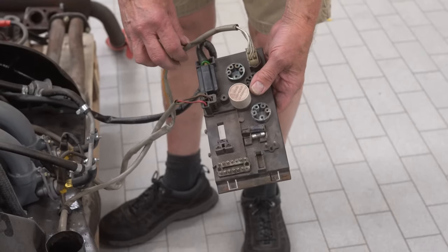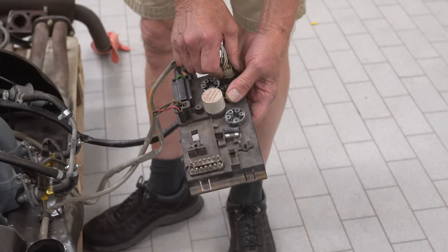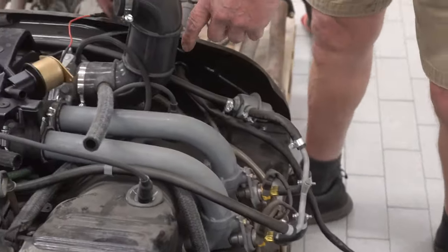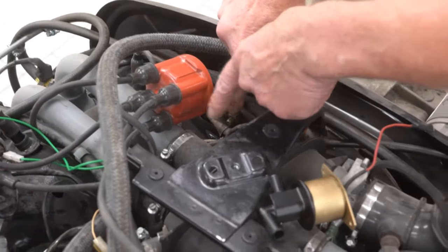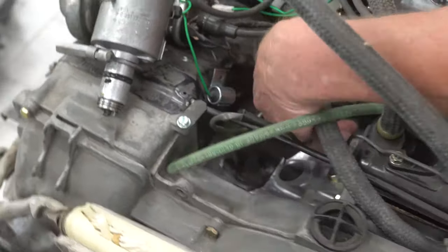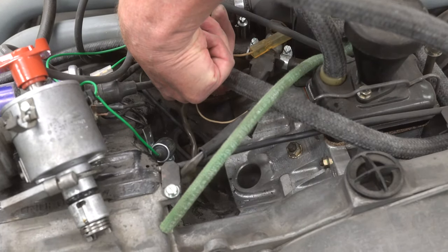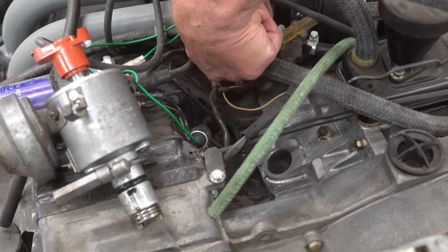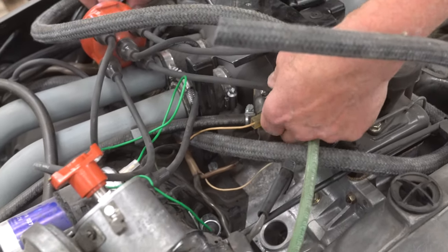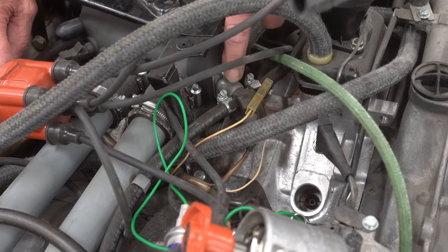Next, we're going to review the control unit harness. Like the ignition harness, it begins at the relay board with a four-prong plug-in, and routes to the back of the engine, then splits — part of it going to the front where the cold start valve is, and up underneath that the thermo time switch. Don't confuse the thermo time switch and auxiliary air valve white wires. The thermo time switch triggers the cold start valve at 40 degrees or colder to inject extra gasoline to start the car only — this only works on the cranking circuit, not after the car is running, and they rarely fail.